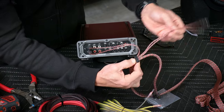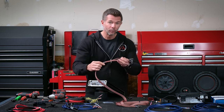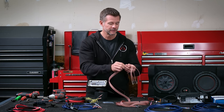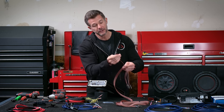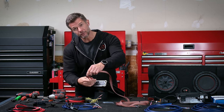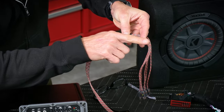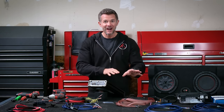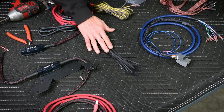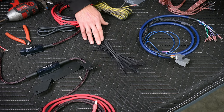The rear is going to follow that same pattern. Something to note with this RCA: this is a directional RCA, meaning it has to be plugged in in one single direction — it's not a bi-directional signal. There's a label on the cable that says 'signal direction' and it points toward the amp end, meaning that end needs to plug into the amplifier. We'll have this all written out in instructions. Go ahead and pick yourself up about 10 to 15 zip ties — you'll need these to strap in the battery cables and the cables underneath the dash.